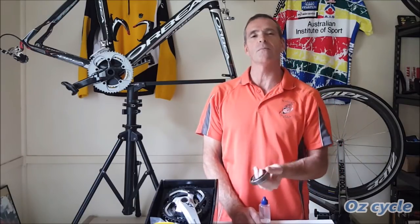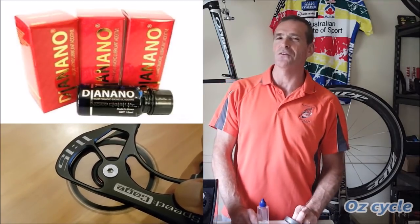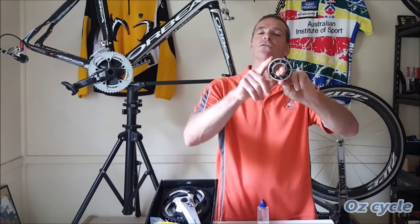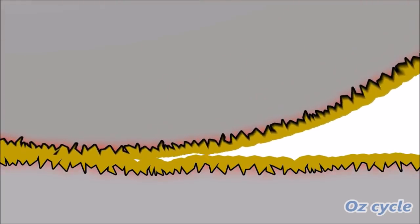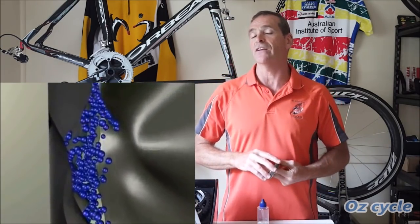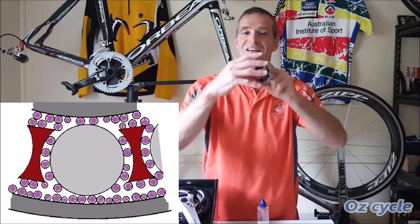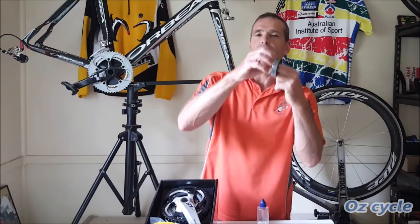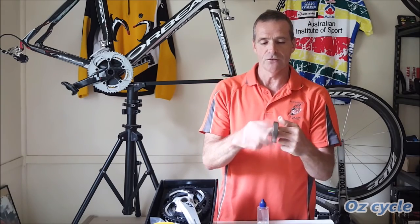In the bike industry at the moment it's all about how friction-free, how long your bearings spin. Now we have nano lubricants — super lubricants that are not just an additive but actually a metal treatment, a surface treatment. If you look at your bearing races under a microscope, you'll see irregularities. These nano lubes fill in those irregularities and make a super smooth surface to roll on, so bearings spin almost friction-free. Some nano lubes also act as microscopic ball bearings — bearings rolling on bearings — making it very smooth. To add them, you'll need to strip out the factory lubricant and treat your bearing as per the nano lubricant instructions.